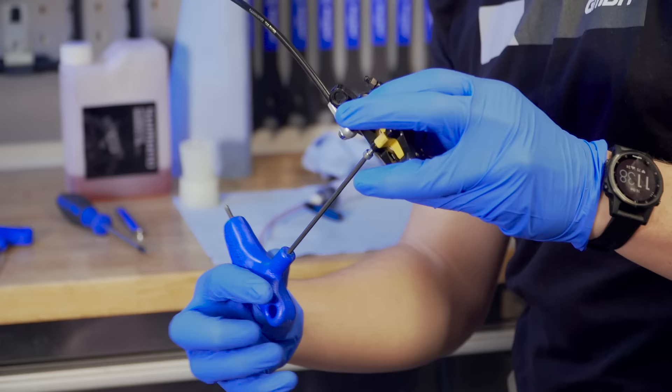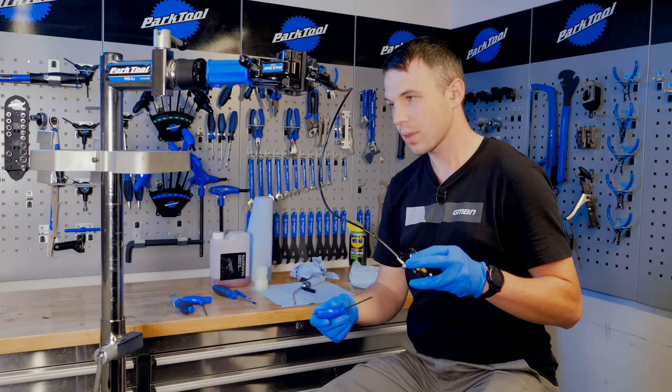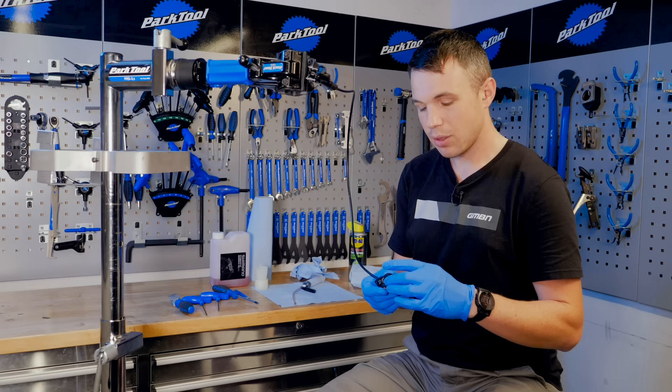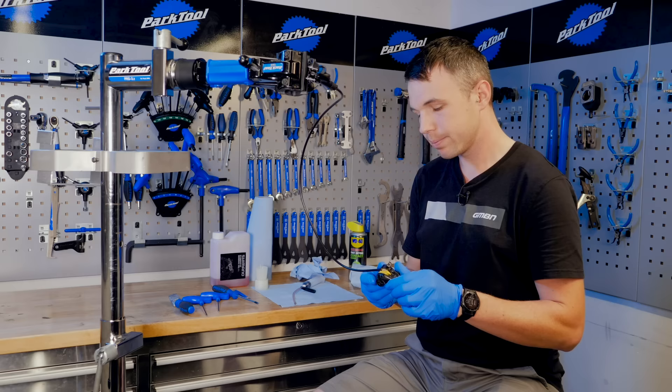You don't need to put the clip on just yet — it's just so we get a nice consistent bleed. Sometimes people don't like the feel of Shimano's lever throw. You could potentially file down the bleed block slightly, which would mean you're essentially over-bleeding the system, reducing lever throw. It will probably also mean it contacts the rotor a bit more if it warps slightly, but it's something people have been known to do.